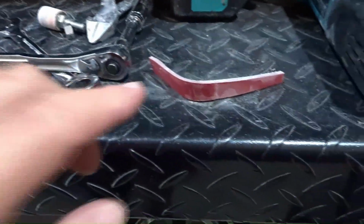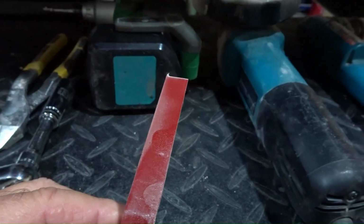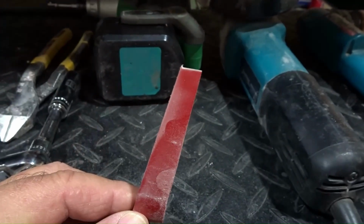Don't take these huge, like 3/4 of an inch cuts at a time. Sneak up on it. So I knew I needed about a 1/2 inch or so from the back of this one. And you can see the piece that I ended up with was just about that. I've done enough of these that I knew that that's what I was going to need. So it's probably 3/8 with the thickness of the blade, almost a 1/2 inch at the top.